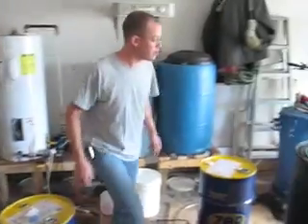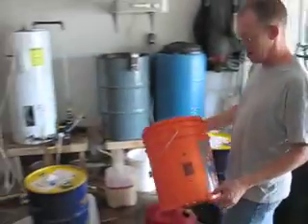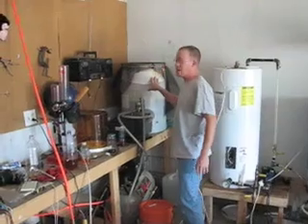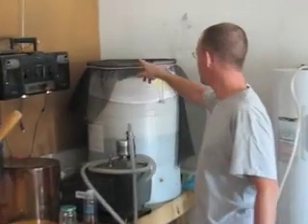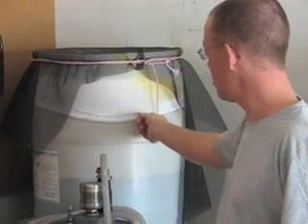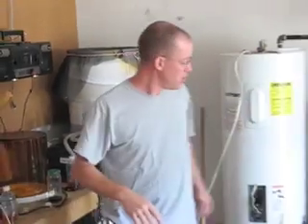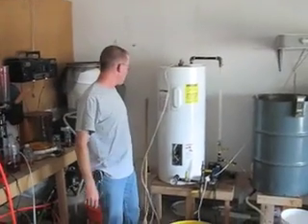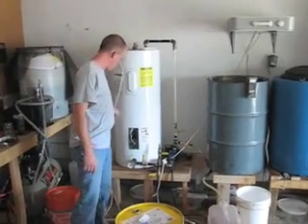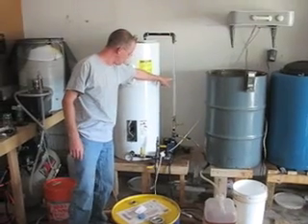I get my grease from Pop-a-Ricks in five gallon buckets, pour it into my 30 gallon oil container. It pours through a screen to catch the big fry chunks, then through a t-shirt with all the neck and arm holes sewed shut. That fills up until it gets to about 25-30 gallons, then using the vacuum pump I basically suck the oil — 25 gallons — up to this line here into the tank.